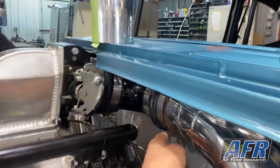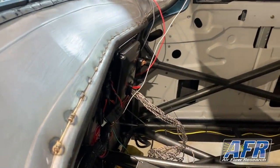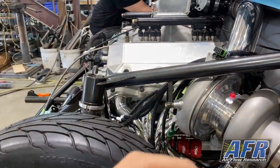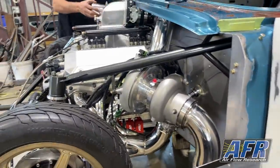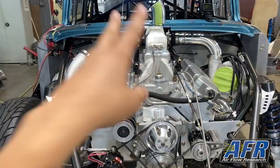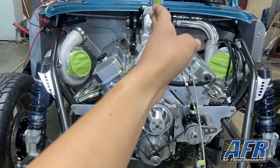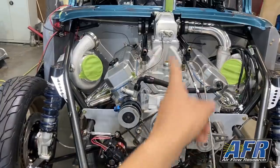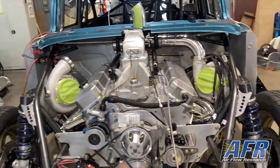Got the coils mounted. The MSD Pro 600 box has that bundle — those go to each coil individually, and then from the coil there'll be a grounding wire that goes to the corresponding head. Each coil has its own ground wire rather than your typical smart coil which just has one that goes to the head for all four on that side. I'm going to run those out as well as the injector driver modules — they each have wiring for injectors — running everything out the center so you can split it with equal length links for the EGTs, both injector driver modules, and the coils.